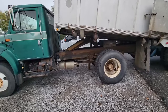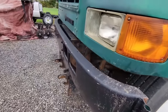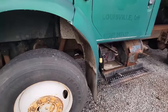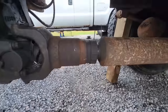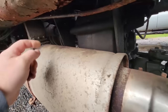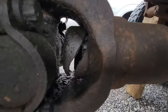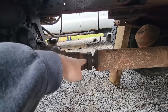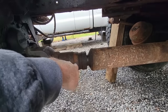It's a four-wheel drive truck, and it has a Boss 9'2 snowplow on it. It came this way when I bought it, and we have the snowplow for it. Well, the problem is that whoever put this together made some errors, and one of them is this driveshaft. This has got a big transfer case right here that interrupts the driveshaft coming out of the transmission. The driveshaft is too long, and you can see the yoke coming through the end cap. So if the yoke's coming through the end cap, that means the splines back here, where they taper off, it's jamming into them — it doesn't have any travel like it should.